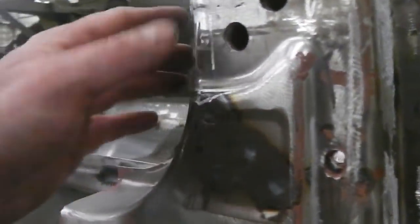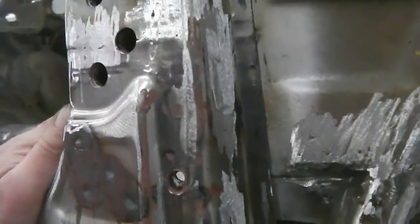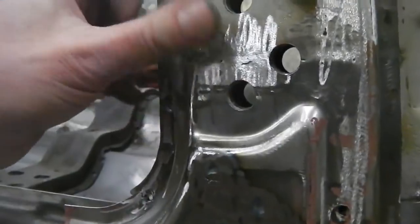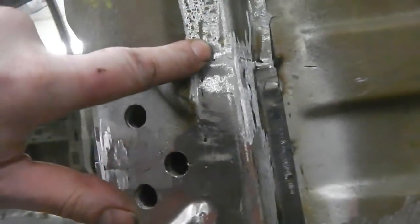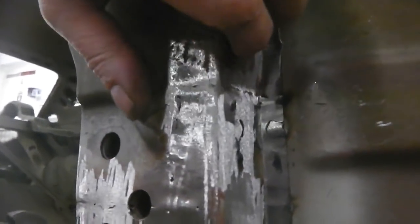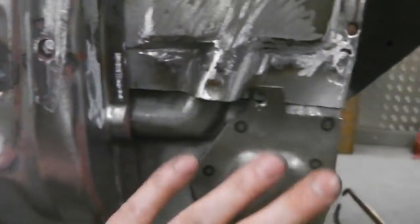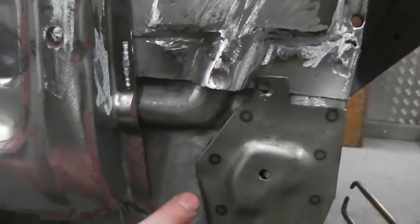It's enabled me to get in all the places that I wanted and create this finished product with the weld, so that all we need to do now is very lightly infill with the metal filler, a little bit of pitting which we can get rid of. And whilst the weld line's there pretty good, you can just still see some of the craters, but the welding's going better. That's a great repair, and look how nicely that inner sill fits and slots over the tab to be bended and welded on when we're ready.